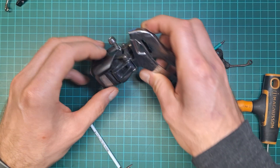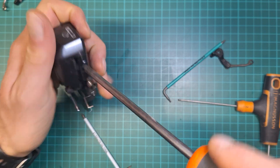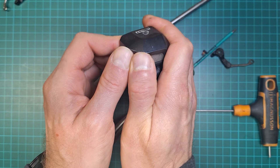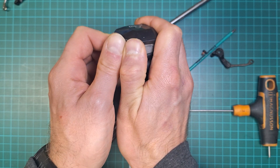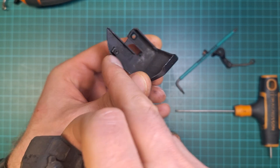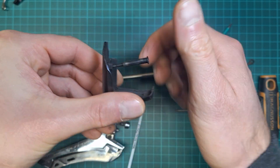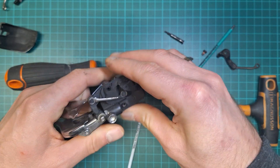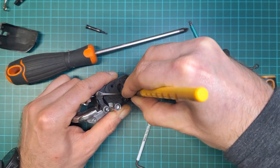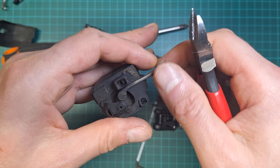So that just slides out. Then you have a Phillips screw, and this cap is held on with a little bit of double-sided tape — you can pry it with your thumbs and just lift it up slightly and that's going to come off. So as you can see, that's your bolt or screw, and that goes in here. Then you can slide it off, but beforehand you have to take the circlips — you can use a knife or cable cutters to lift it off, and that nicely slides off.